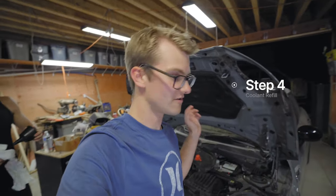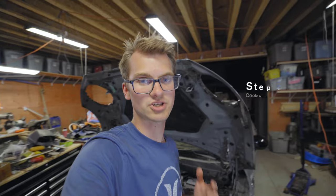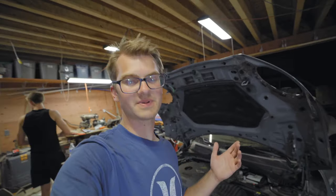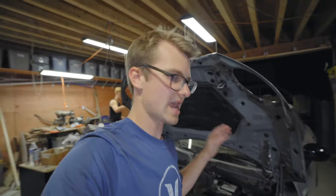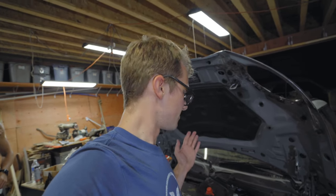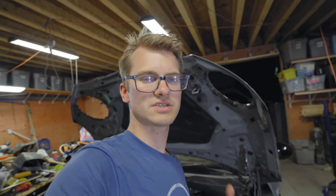The next thing is very exciting — we're going to top it up with coolant. For the first time, the engine is going to be filled with coolant, as well as the turbocharger, since it's water-cooled. This is a very important step, a huge milestone — this car has been completely torn down and the radiator was actually leaking. It should take around five to six liters depending on the car, but for this one it's around six liters. We have a 50/50 mix.